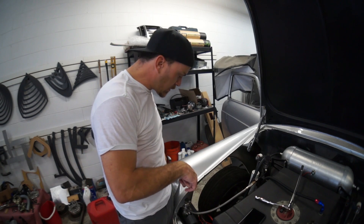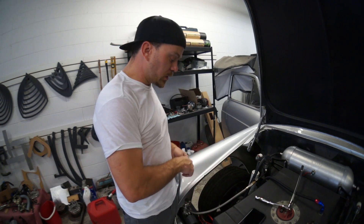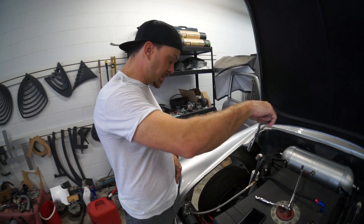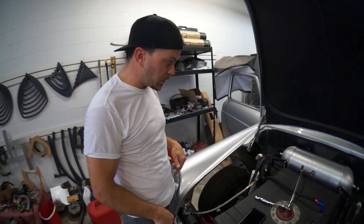This is an 80-amp relay designed for high current flow. I have a 4-gauge wire ran from the battery to one of the terminals on the relay. The other terminal goes to the compressor, and I ran 4-gauge so I could add another compressor on the other side — that way the tank will have two compressor inlets and two outlets going to the manifold. The compressor is grounded, the relay is grounded, there's power to the relay, power to the pressure switch, and the pressure switch comes back to turn on the relay.